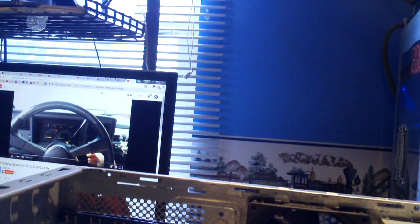So what I'm going to do is see if we can get this thing started at all. I'm going to use a paper clip and insert it into the green and black wires on the power supply itself to see if we can forcefully start it.